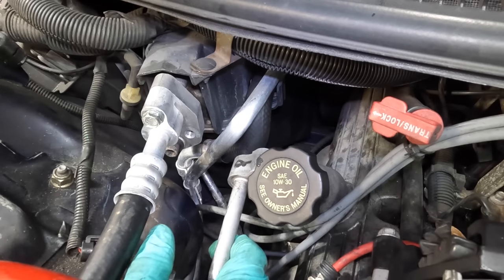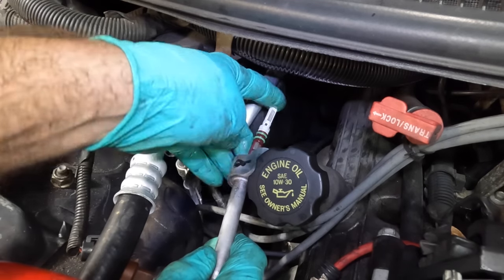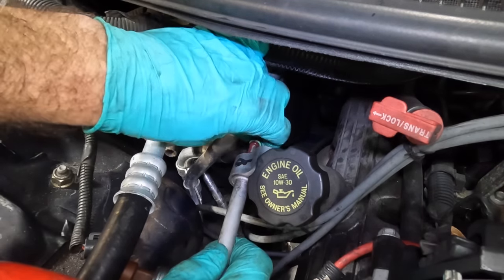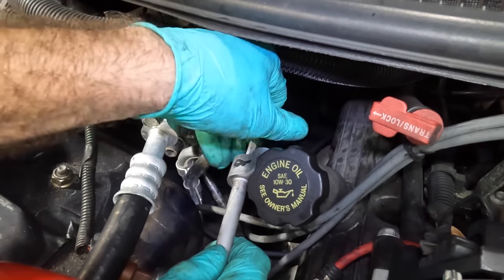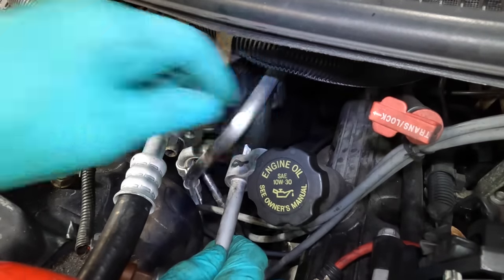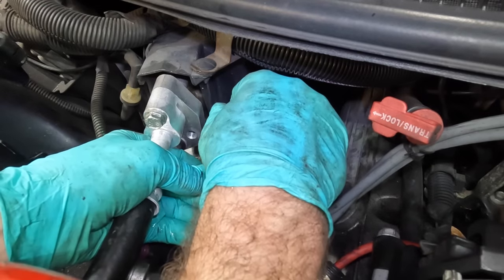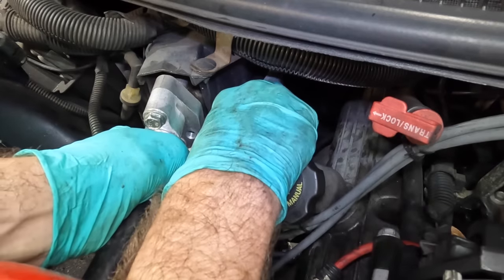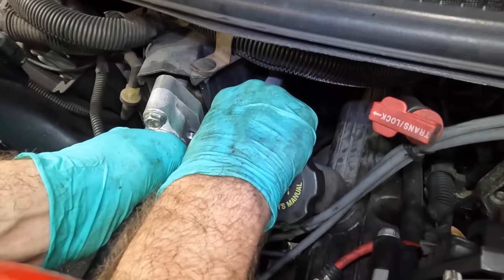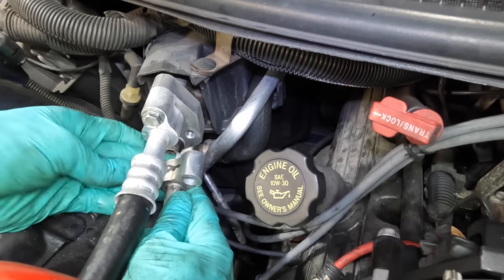All right, I got one. I had one in my box there. Spec says that the OE orifice is the red color. The color indicates the diameter of the orifice inside of the assembly. So there's black ones and white ones, and yeah, I think maroon ones. Get in there, tube. Press that all the way down. There we go. Now we can get this guy back in.